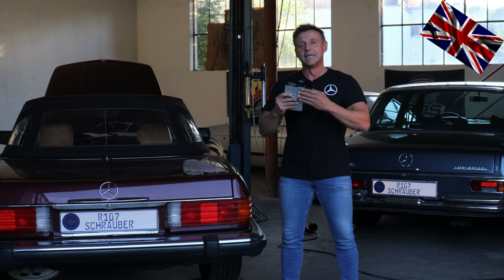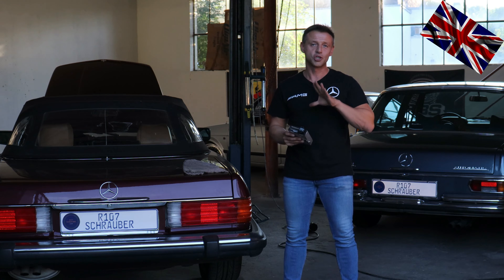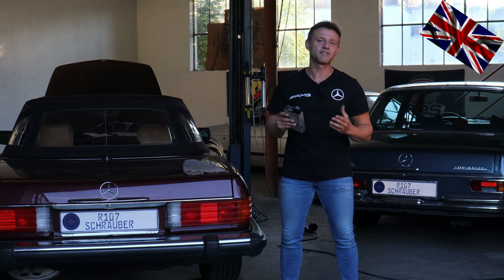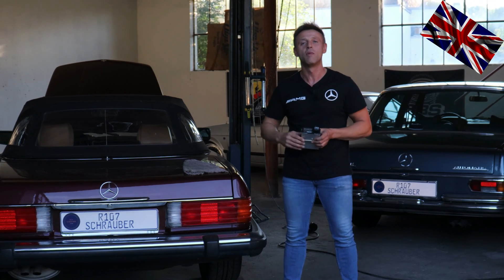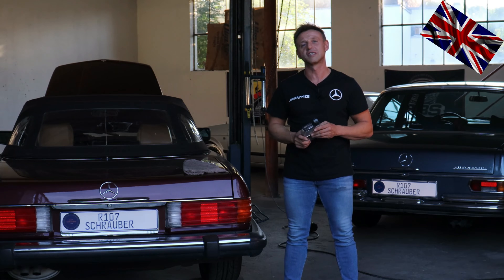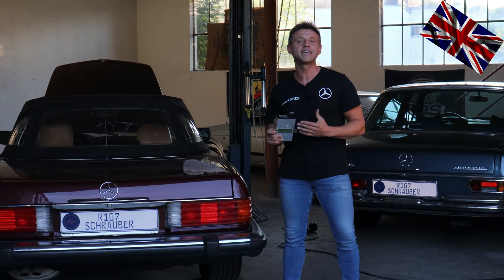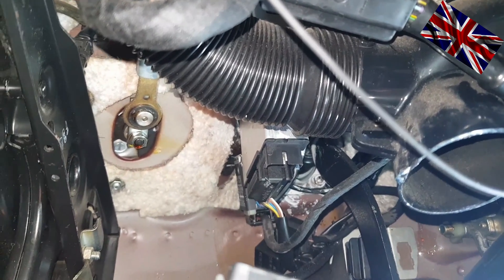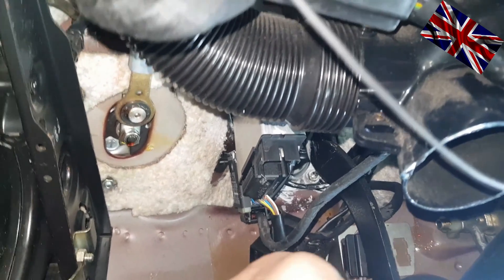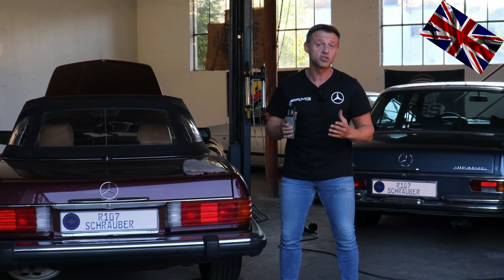This here is the culprit. In addition to that, the engineers at the factory are making fun of mechanics working on stuff like that. This thing has been mounted on top of the driver side footwell, hidden next to the steering column above the pedals. You will have to crawl into the footwell on your back, your legs facing upwards touching the headrest, your head touching the pedals. Now you know why mechanics hate engineers. You need to unbolt that relay first to get access to one of the screws of the housing of the cruise control. It is hilarious.